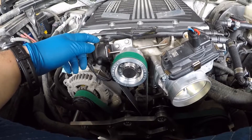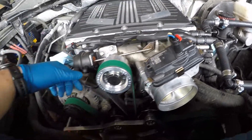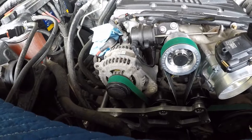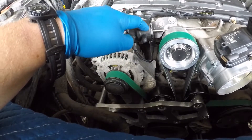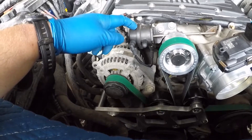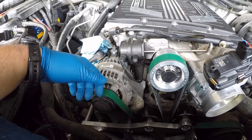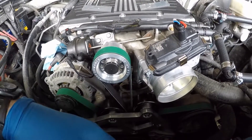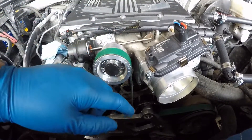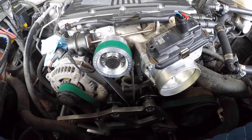I think that's pretty much it for this video. Off camera I'll grab another cap and cap this last port off. To recap: we got the boost port plugged off, we got the boost port on the bypass actuator valve plugged off, and we got our vacuum source connected to the vacuum side of the bypass control valve. No solenoid needed here. Getting really close to the end — the only things left are wiring up the pump for the supercharger and doing the induction. Thanks guys, I'll catch you on the next one.